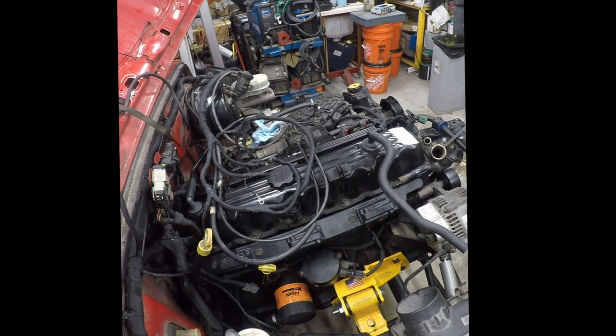Hey Siri, what's 250 divided by 12? 250 divided by 12 is approximately 20.8333. So, let's see if we can go down to 20. So we can, so we'll go to 21 on our 3/8 wrench, because 250 inch pounds is too much for the other torque wrench. So let me switch over.